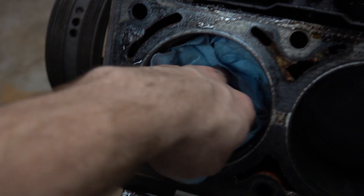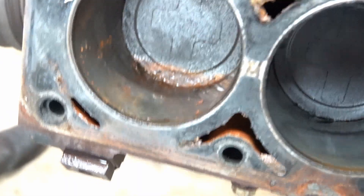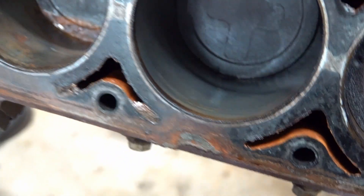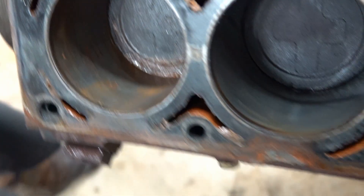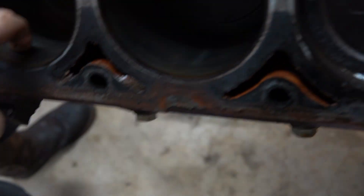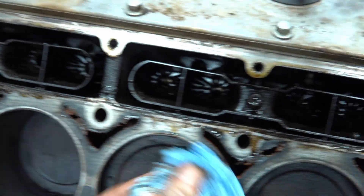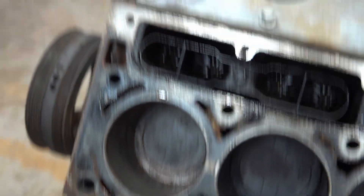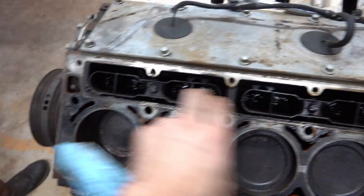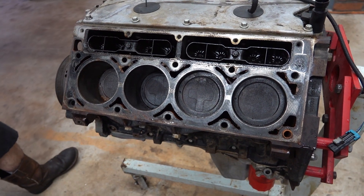Let's see how this looks now. That's kind of nasty. Most of that just came off. Brake clean. I'm really tempted to spin the engine over and try and clean most of that off the rings. So far, we're not looking too bad. From what I can tell, it looks like everything's still good. I'll pull these off here in a minute, and then we'll look at the lifters, and then we'll slide the cam out and see how it looks. But so far, these cylinders on the driver's side look all right.